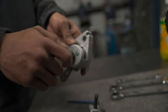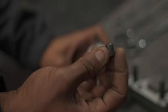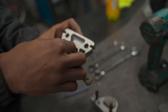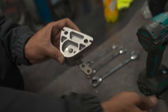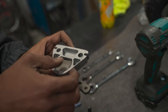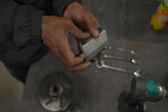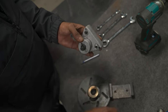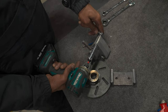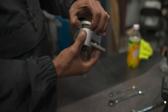Go ahead and insert the jam nut just finger tight. Install your brake pin with the round part in the caliper — remember the flat side of your pin should be facing the brake pad. Before you insert your brake pad, seat your puck-style brake pad in the caliper, making sure the puck is sitting in the sunk hole for it, then install your 14 millimeter bolts.